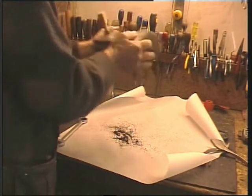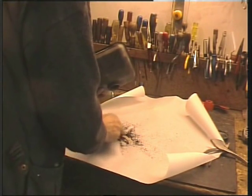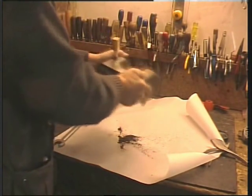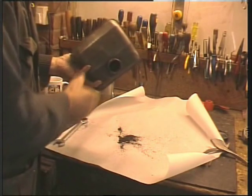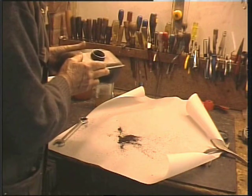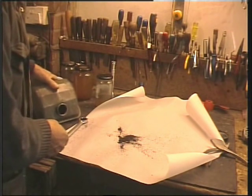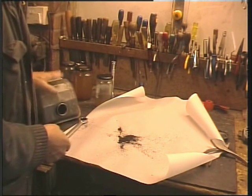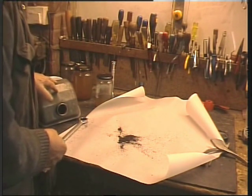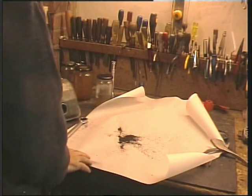And it is the acid in the Coca-Cola that turns this oxide, not just oxide, look at that, it's other ingredients, absolutely black, but whether that's the approach or not, I don't know. But the object of the exercise is to completely clean that out, of course. And when I've done that, and I won't show that procedure, but I'll carry on cleaning this, and I think we can then conclude that the fuel system has been dealt with.